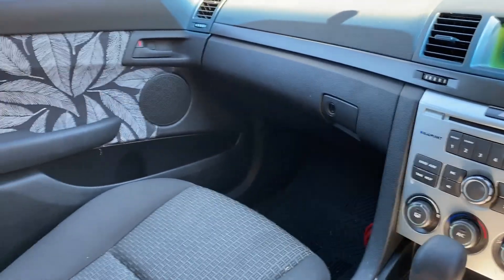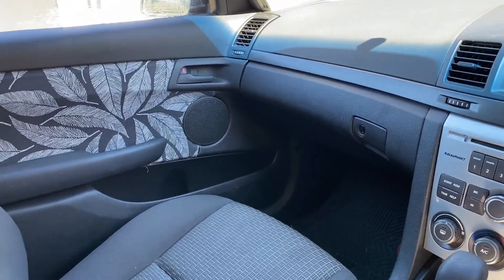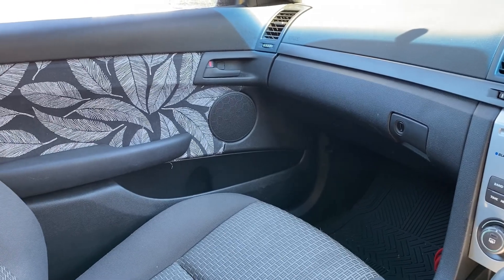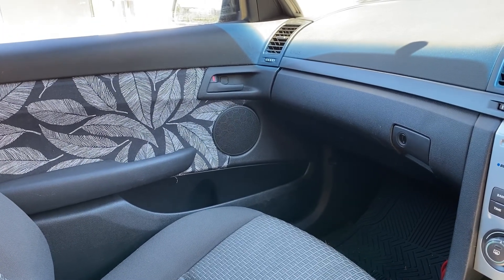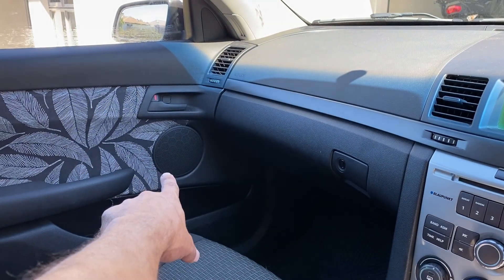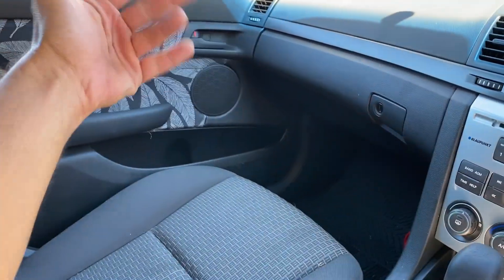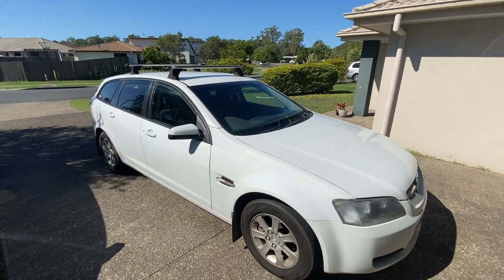In terms of the front stage, I like to listen loud and I've pretty much blown the front speakers apart — the cones are gone and there are some vibration sounds, but the bass is up so high I can hardly hear it. They're about six inch speakers. If you want something better, I'd keep the tweeters — tweets are tweets — but the door speaker behind the panel is an easy swap out to a quality unit with a bit more clarity in the mid-range.